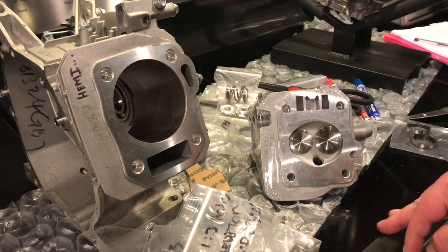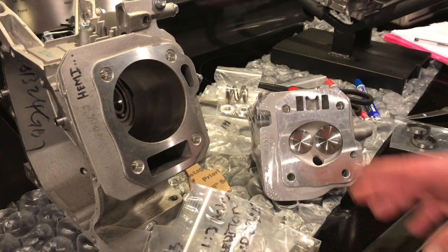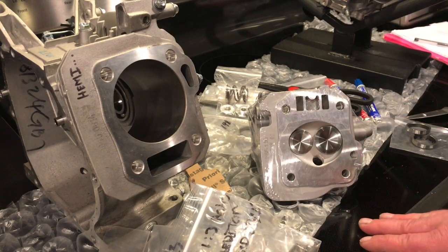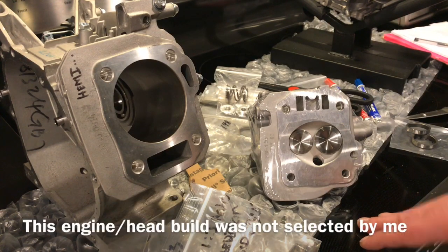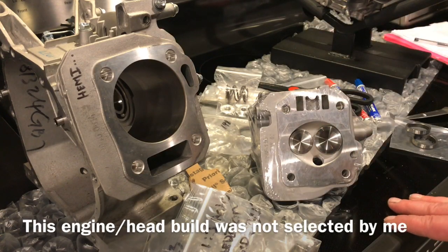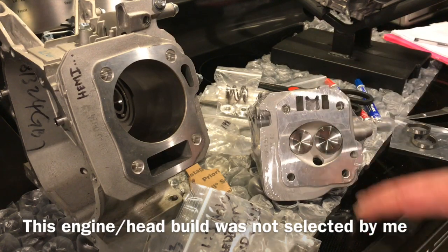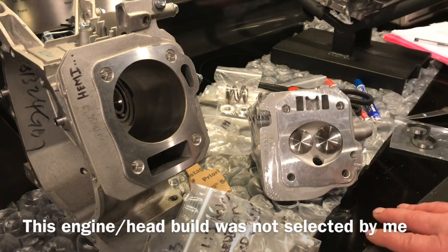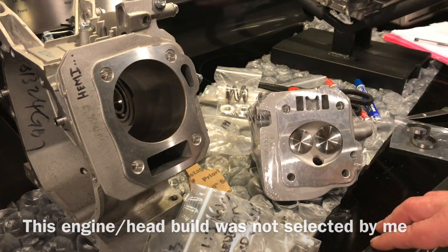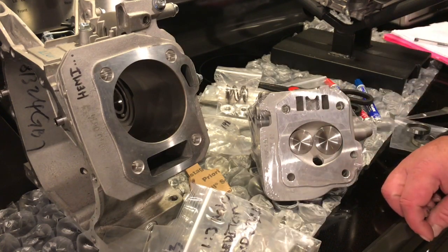on this. I'm not really sure about the direction of this build. I know he's trying to go all out, fully modified. There would be different things I would do. I would definitely use a different head, but this will definitely give you a lot of compression. Not that much flow, not that much chamber work, dealing with cylinder fill and keeping that fuel atomized. There's real power to be made in just fuel delivery.